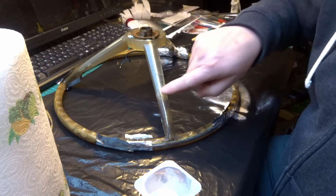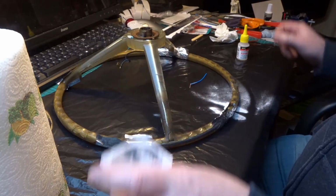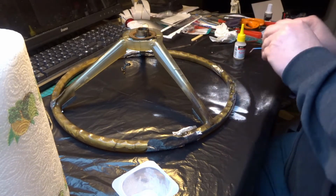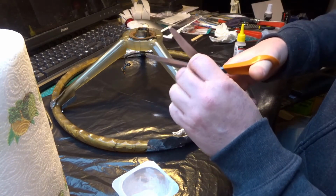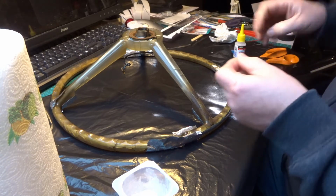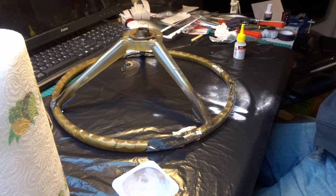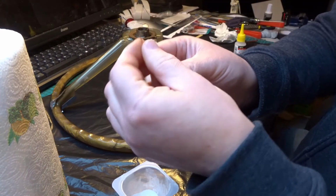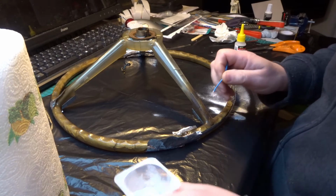I'm going to repair this crack using the superglue and bicarbonate of soda method. Now you're supposed to use a needle, but I'm just using some wire. I'm just stripping off the insulation at the end, and then we'll just keep a few of the copper strands. So we've got like a little prong here. I can get into the crack with it, and I've just been doing this by trial and error.